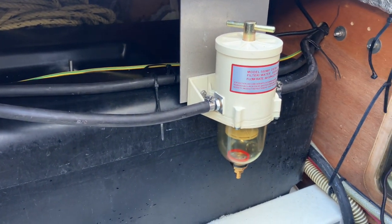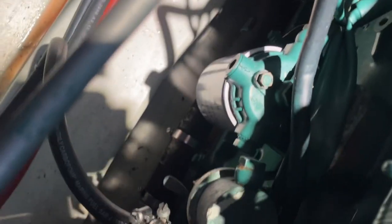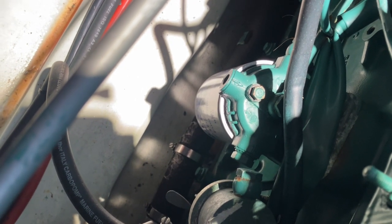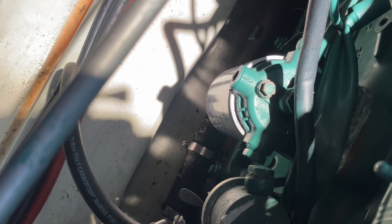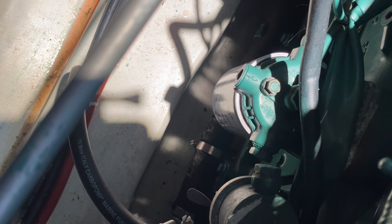So there's my fuel tank. There's one filter there, then it goes through to another inline filter just down there, and then we go to the filter just there — you can see the nut on the top. That is a 10mm nut. First off, you need to crack that nut — I've already done that, so it's already loose. We're all ready to go.